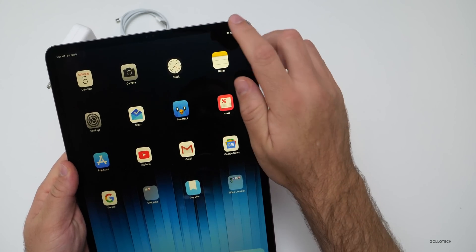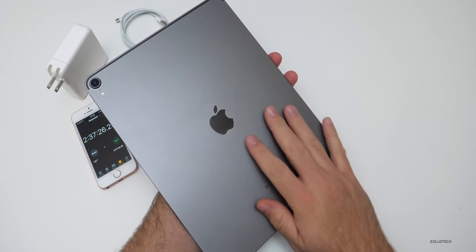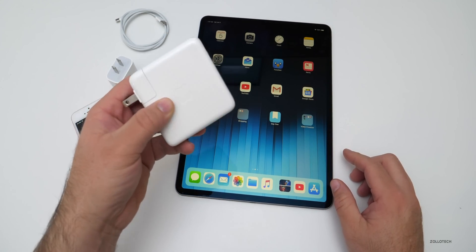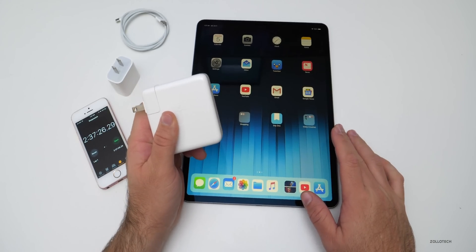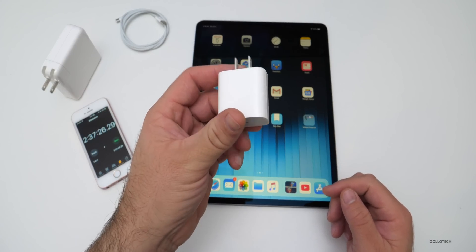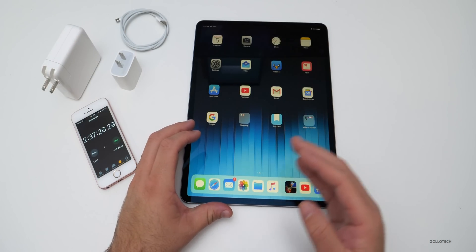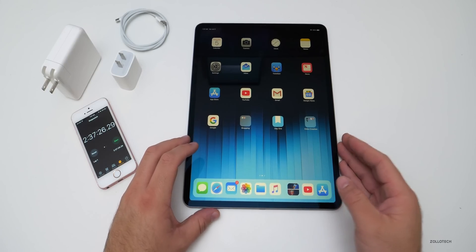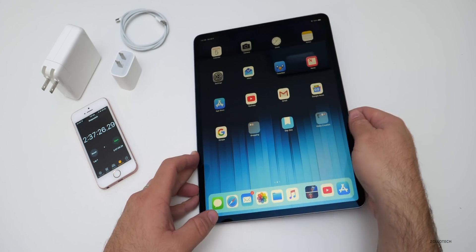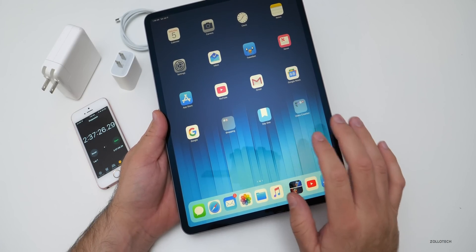We reached 100% and the iPad itself really wasn't warm — the back wasn't warm at all, no issues, nice and cool, which is a good sign. Although I wouldn't necessarily recommend using this on a daily basis. I do use it when I'm in a pinch from time to time, but if I'm going to charge from 0% or 20% up to the top, I usually use the standard charger to preserve the battery over time. You don't really want to fast charge repeatedly, because — similar to some other devices like cars — the heat will really deplete the battery. But again, this really wasn't warm and it seemed to hold up pretty well.